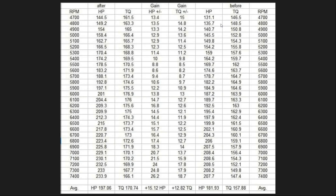On this test, the motor was a stock imported F20B. It was a manual with stock cams, stock valve springs, stock retainers — stock everything. It's not an H2B swap; it's a full H swap. He was on E85 for fuel, and the only change was the intake manifold. On the left side here is the readout after he fitted our manifold and retuned, and on the right side is his previously ported manifold — a do-it-yourself job that he had tuned a few months prior.